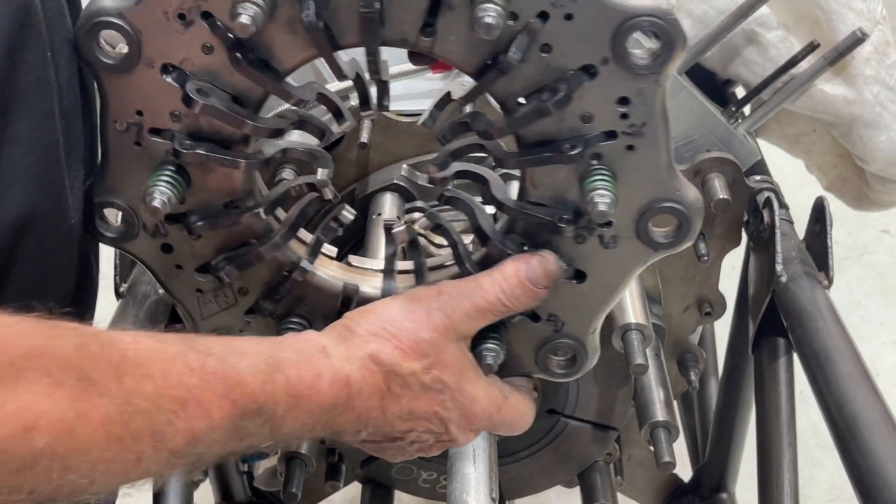It depends on what competitor you're running — some people like to hold you on the line a little bit, so a tighter clutch pack means the car will react quicker if somebody holds you out on the line for an extra five, six, or ten seconds. That's why it's very critical. Most people are gentlemen and they don't hold you on the line with a fuel car. When you're in the car in pre-stage and you take your foot off, you haven't got long before the clutch — you're basically trying to slip the clutch all the time and it's heating up, so that 40-thou gap disappears fairly quickly and it will pull you through the lights. This is why there's an agreement that nobody mucks anybody around. You'll see the two crew chiefs on the line nod to one another — it's just acknowledging that my driver's ready to go. In America I think it's about seven seconds, that's all you've got, so most people don't muck around because they don't want to ruin their run.